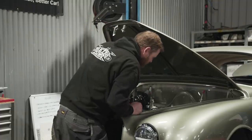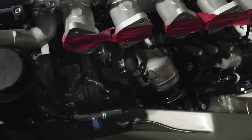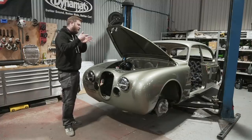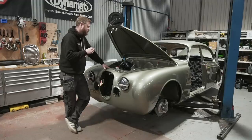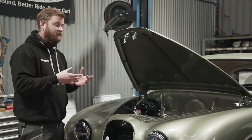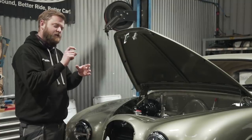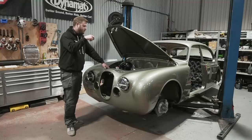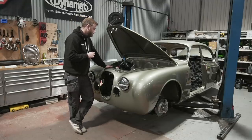For the ancillaries, the air-con compressor is the original Toyota unit. Those compressors use a flange-type fitting - an aluminium flange welded to an aluminium hard line, bolted on with an O-ring. For the system we're using, all fittings are threaded screw-on type, so we wanted threaded fittings on that compressor too. There's a removable top plate on the compressor with the original pipe flanges. We've machined our own threaded stubs with the right O-ring detail, welded them onto that top plate, pressure tested it - all okay - and fitted it up to run with the threaded-type air-con lines.